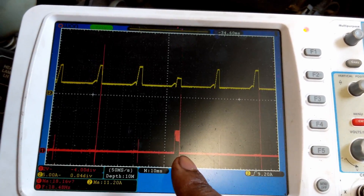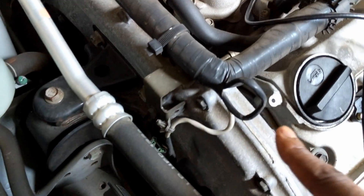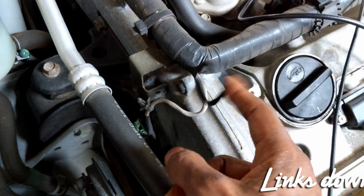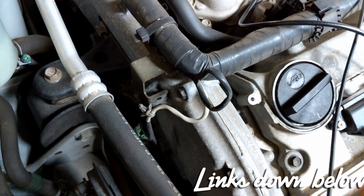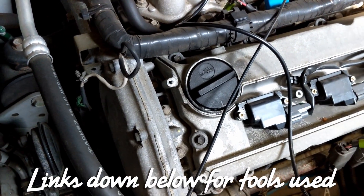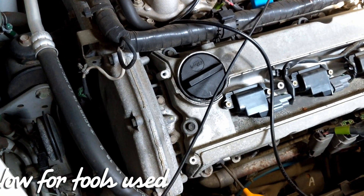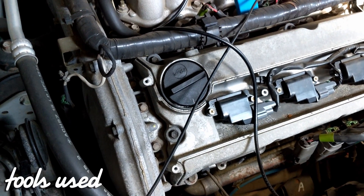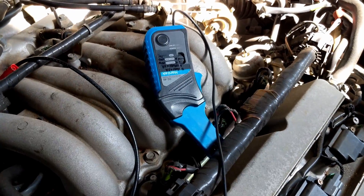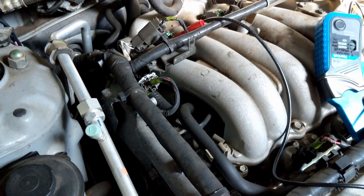Another method to synchronize your parade pattern and find out which cylinder is which is to hook up a second amp clamp to that loop right there, which ties into the number 1 cylinder. It's used for adjusting timing on Nissans, because you can adjust timing using the scanner with most Nissans. Pretty much every Nissan has a loop somewhere on the wiring harness in that area — it might be on the valve cover or right next to the timing cover. You'll see some wire sticking out that looks like a loop that doesn't belong there.